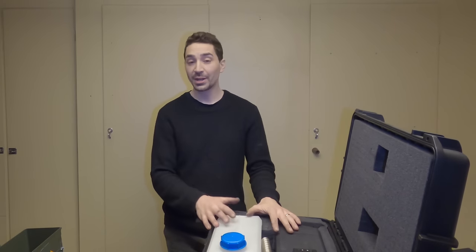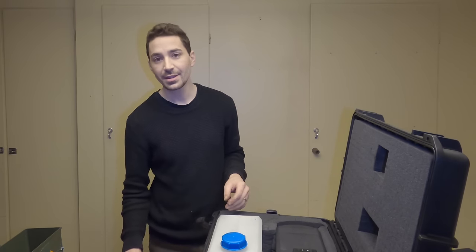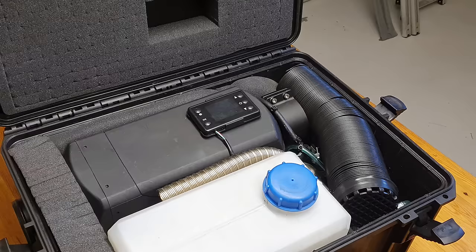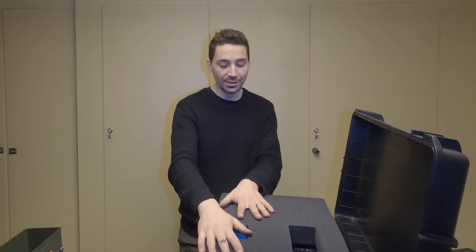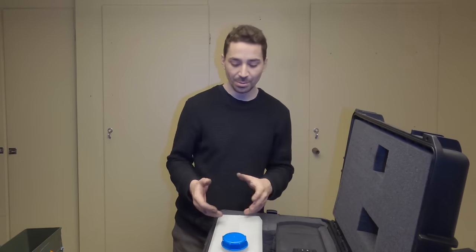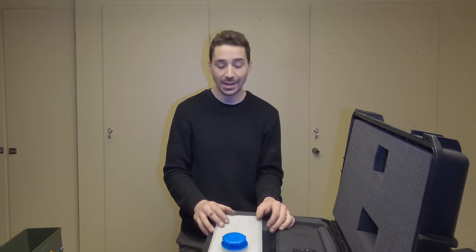Before I get into any more changes with the fuel system, it's time to test the unit. I've just connected the silencer so when we're sleeping at night we can quieten the unit and direct the exhaust gas away from the intake. I've insulated it with lots of foam and raised the fuel tank a little more on two hockey pucks, adhesived down with very tough adhesive. Still got plenty of clearance in the lid, and when we shut it we don't have to worry about cutting off the air supply to the tank.